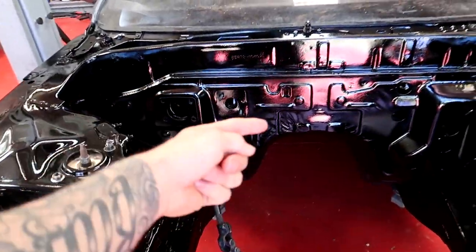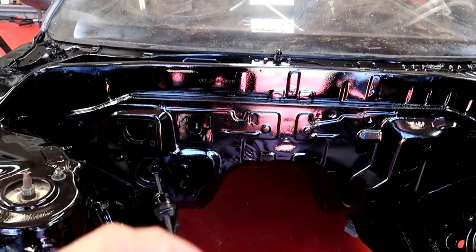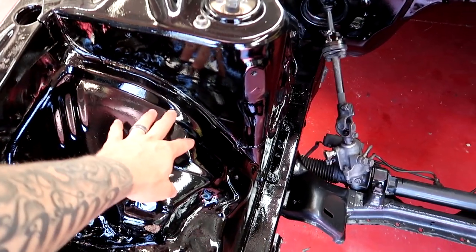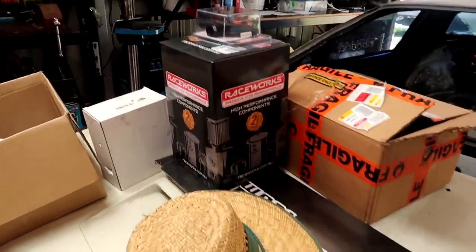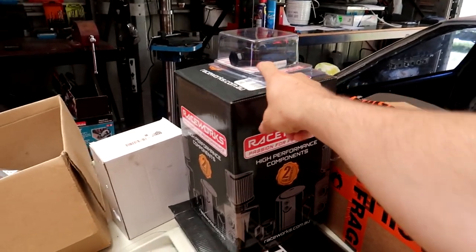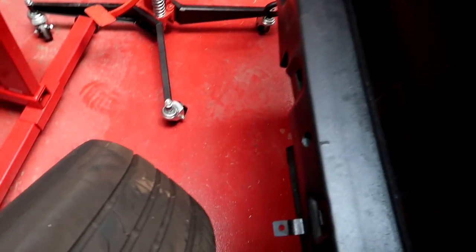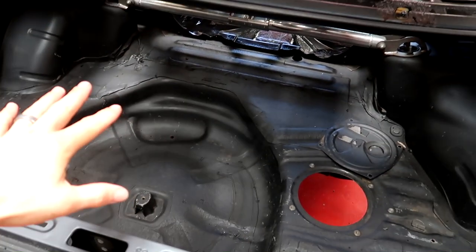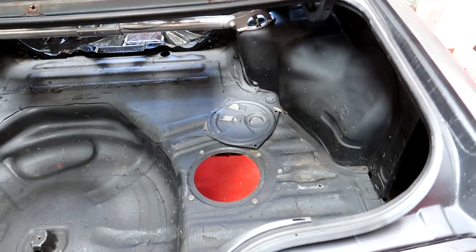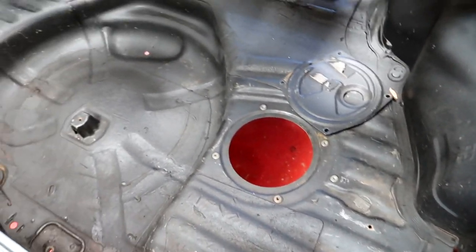There's going to be the brake lines, the clutch line, the fuel line, and the battery relocation — a thick battery wire that goes from a terminal post somewhere under the car to the back where the battery will be in the boot. I also started buying some fuel stuff second hand on marketplace — I've got a surge tank and some fittings, but I'll need to buy the hose and the rest. In the boot, I'm going to work out where to put a fuel cell, maybe cut it out to make it fit nicer, and figure out where to run the lines.